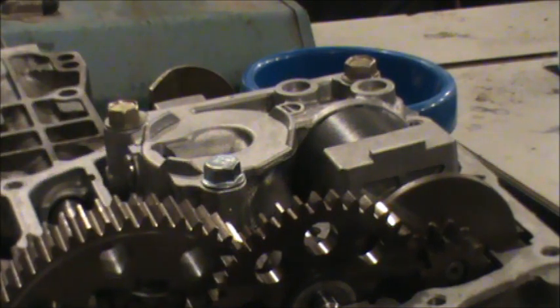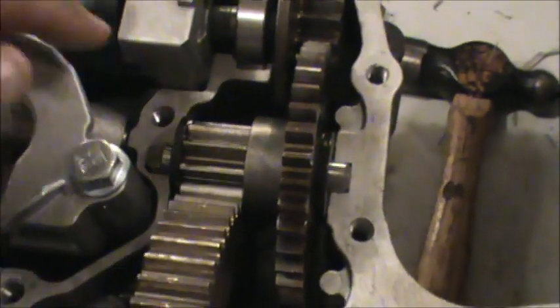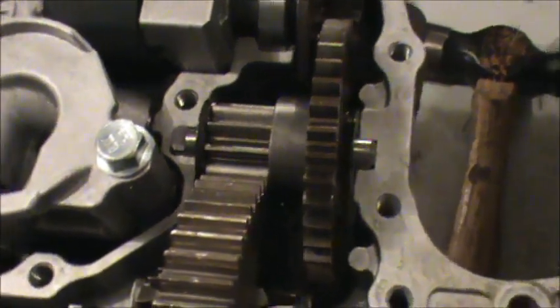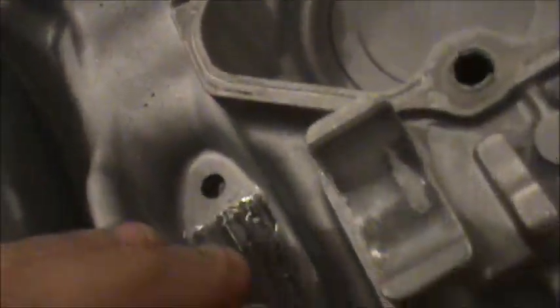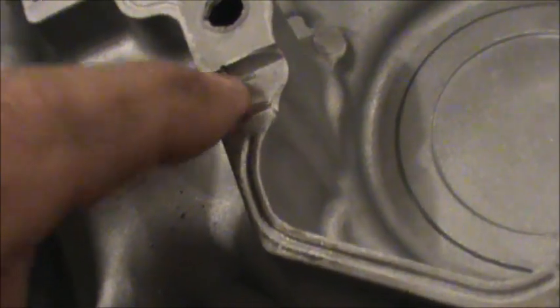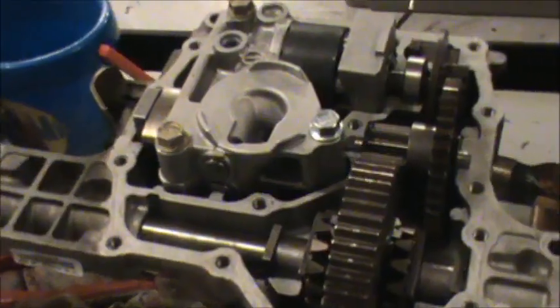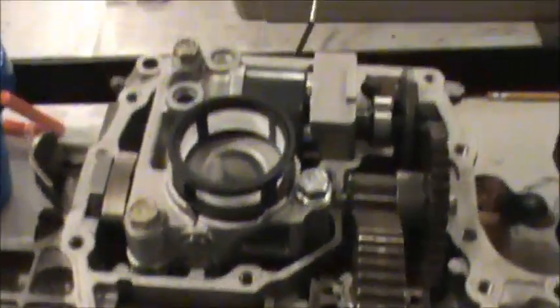Here's a look at that set of gears I just put in — I'm leaving the flat side facing up. The reason I'm doing that is if you look at the top of the housing, you can see right where that flat side rubbed against this casting, so that's exactly where it's supposed to be. My new filter is going to go in place right here.